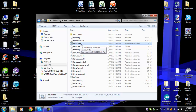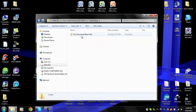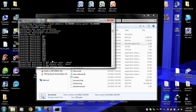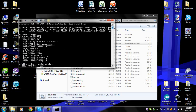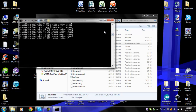It's going to actually reinstall Honeycomb, and that's why I have this here — because we're going to have to manually install the most recent version. Over the air updates don't work after doing this process until you manually install one version, and then the over the air updates will work fine. You'll know if it works if all this comes up. If it just stays at the top two lines and never goes farther, that means you are not in APX mode — which is basically when you hold the volume up and power button — and it means you just have to hold them longer.